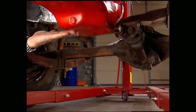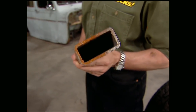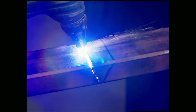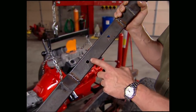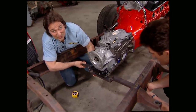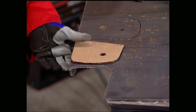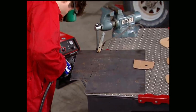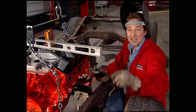Make sure you don't go too low or you could have clearance problems with your oil pan and exhaust. On our application, we need to drop it two inches. I'm going to use one-by-two thick-walled square tubing for extra strength. Make wedge-shaped cuts about an inch wide — you can do this with a hacksaw or cut-off wheel. Then bend the tubing and weld up the seams. I've already drilled the holes for the transmission mount so Stace can bolt up the crossmember. Once it's in place, we can start building the motor mounts. To make each mount, we'll make a cardboard template to get the right size, then trace it, cut it out of plate steel, and weld them on. Now you can tack your motor mounts in place, then make sure you check your six clearance points one last time. If they check out, weld them in place.